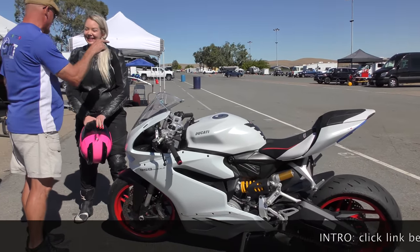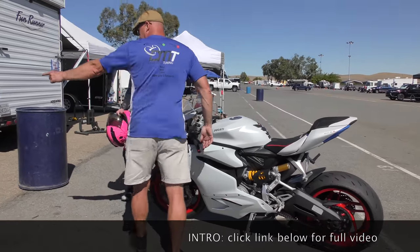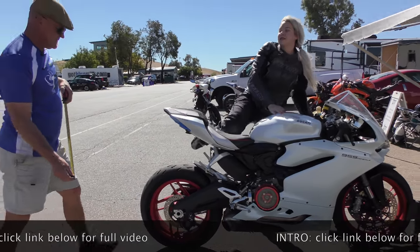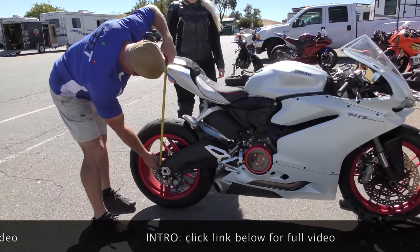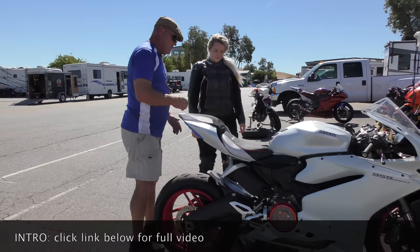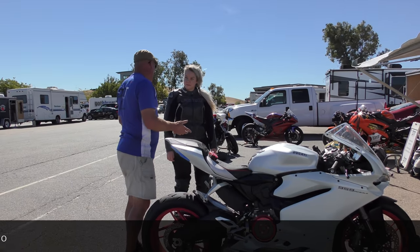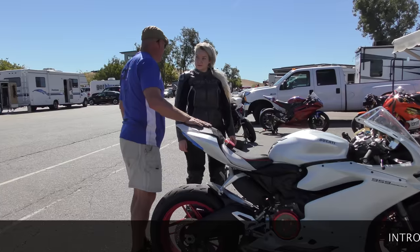It wasn't the finger pointing telling, was it? So, helmet and gloves in the chair — we don't need those. So, 35 in the front and you are at 15 in the back. One of the very important things about a motorcycle is it's got to collapse under your weight, and the ideal measurement is 20 to 30 millimeters. You're at 35 in the front and you're at 15 in the back.